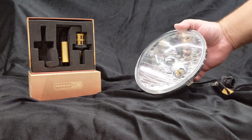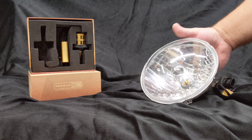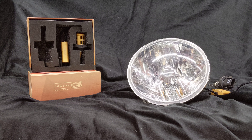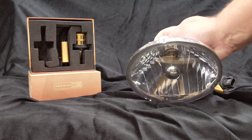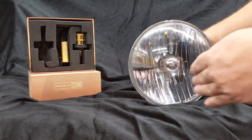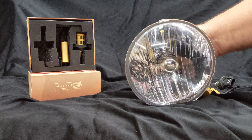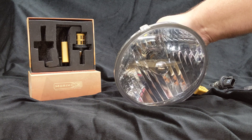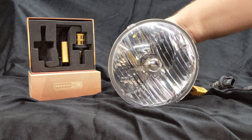Simple enough installation. However, there's something you need to pay attention to and a lot of people do not pay attention to this. When they install them in their vehicle, they don't get proper light output because they've put them in but haven't completely installed them yet. If you look here at the top, you can see the LED is not parallel with the facets inside the headlight — it's actually out of rotation by about 15 to 20 degrees.